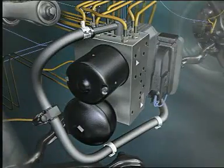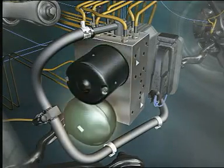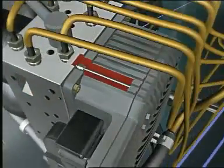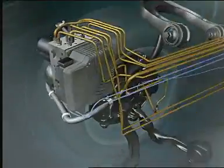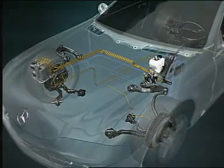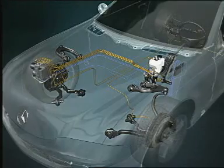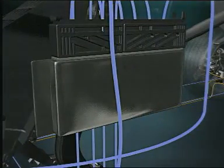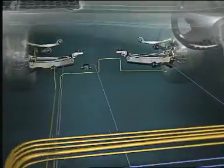The central control unit of SBC is an efficient component integrating the pump motor, the high-pressure reservoir, the hydraulic valves, the pressure sensors and the SBC microcomputer. For optimal brake intervention, the SBC computer is also connected to the control unit of the electronic stability program, ESP. The control unit uses various sensors to record the motion of the vehicle.